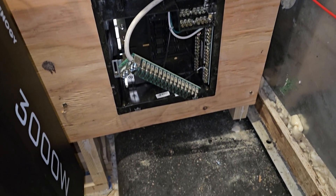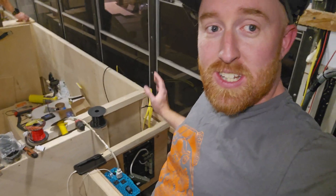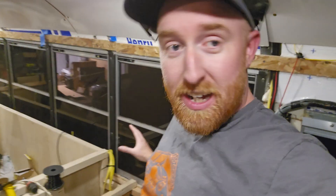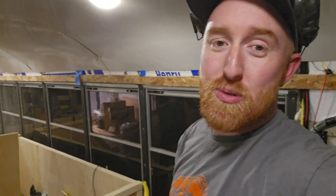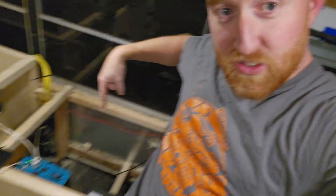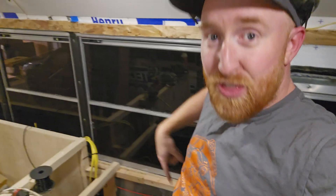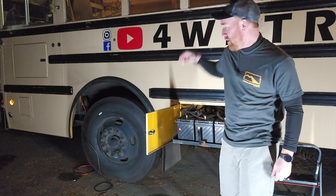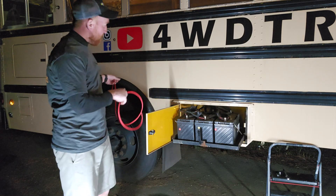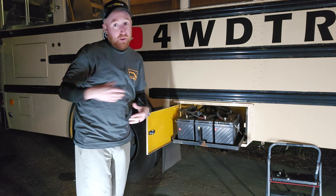With this panel now bolted in and the fuse box with all the breakers in place, it looks a lot better. It's going to tuck everything hidden away underneath so you don't see any wiring or breakers. It also keeps everything all in one spot when it comes to electrical — batteries, inverter, solar, breaker — and I'm going to have another little section for the DC to DC charger, with lots of ventilation to keep everything nice and cool. Coming out here I'll be hooking up the DC to DC charger to the physical batteries — power cable and ground cable running up underneath the bus and through the hole in the backside.